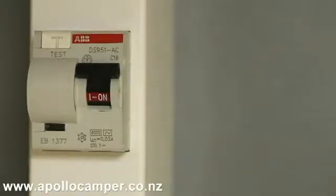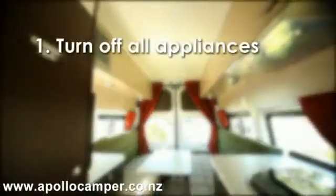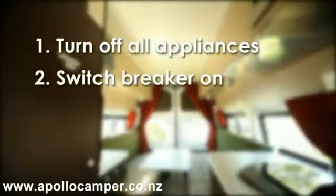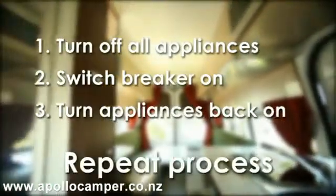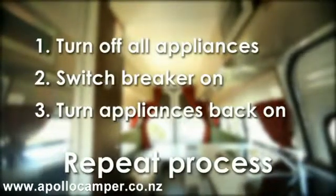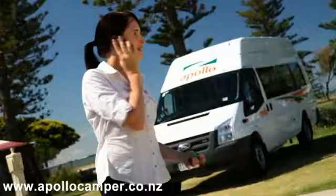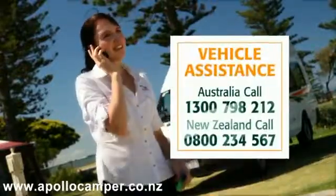The mains power system is protected by a circuit breaker. Ensure that this switch is always in the on position. If the circuit breaker trips, turn off all appliances and reset it by switching it back on and turning on your appliances. If it trips again, repeat the process but turn on your appliances one at a time until you identify the problem device. Then contact our customer support centre on the number located on your key tag.